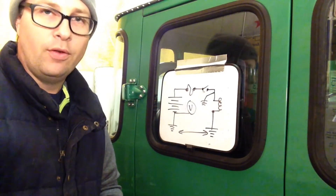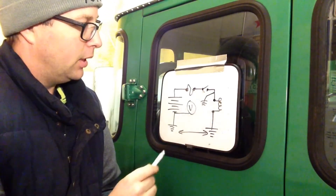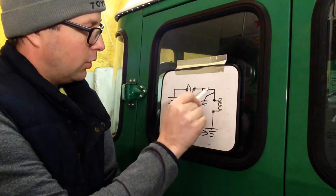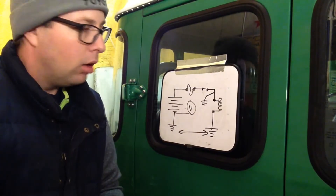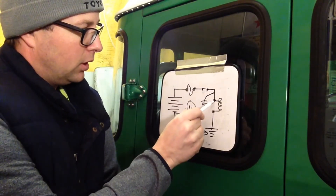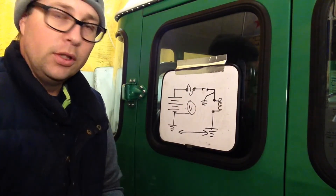This is a very easy way to find a problem on a live circuit. I keep going all the way along and I should get 12 volts up to the load. So with the switch on: 12 volts, 12 volts, 12 volts, 12 volts — then I got 7. Automatically I know everything up to the output side of my switch is good, and between the output side of my switch and the input side of my load, there's a problem. If I'm getting 12 volts here and 7 volts there, something is stealing voltage.